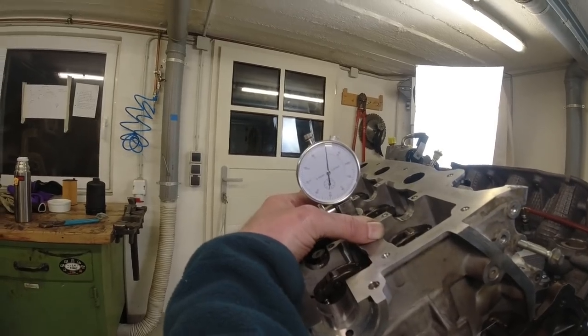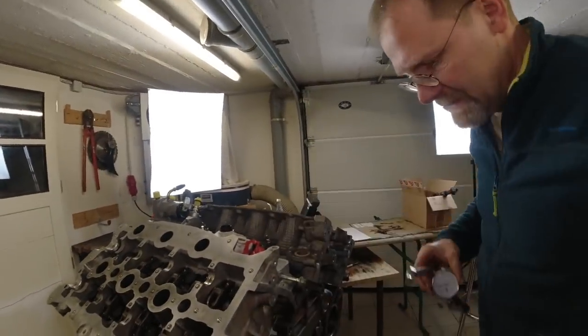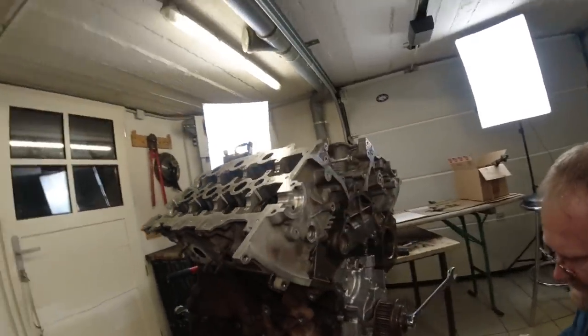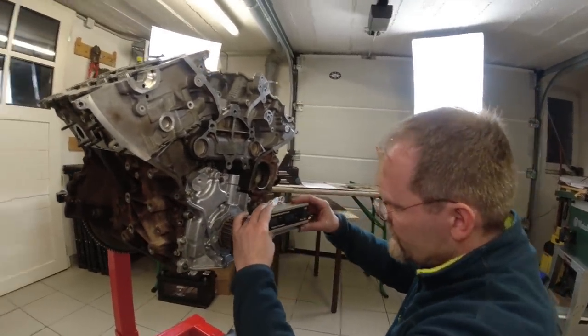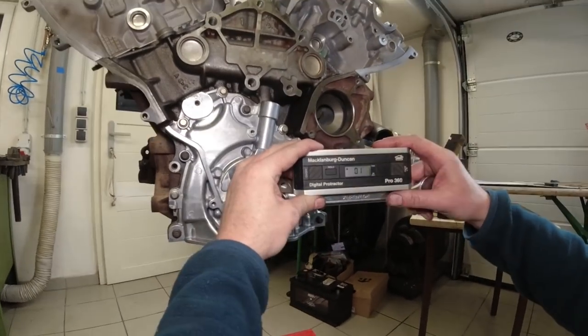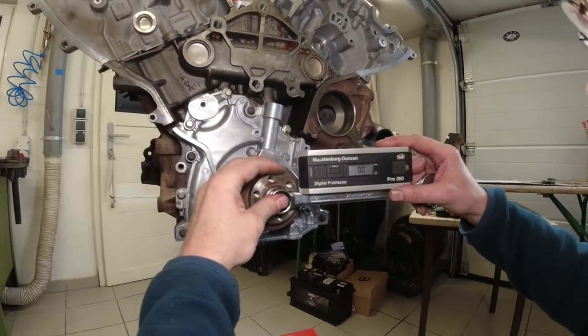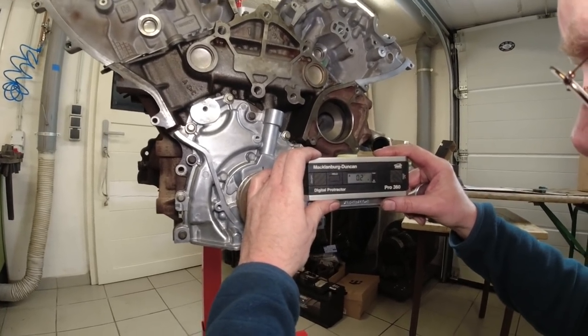That's top dead center, right? Yep. You take your little chopstick back out. So you need a precision angle finder here. And you set that on the wrench here. And you zero it out. And now I gotta find that in one clean sweep. I can't go back.